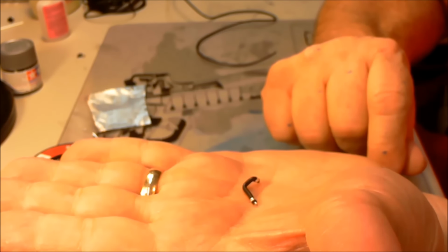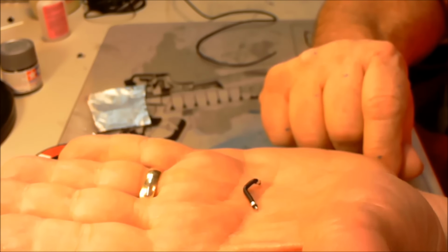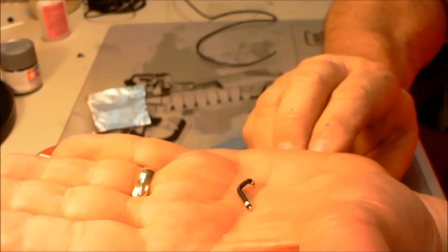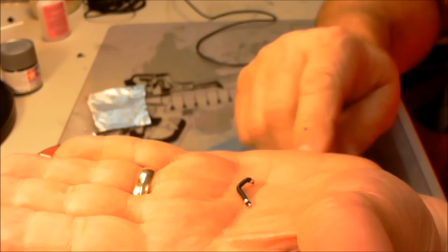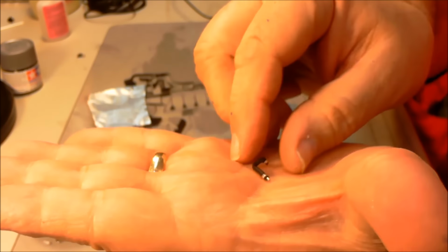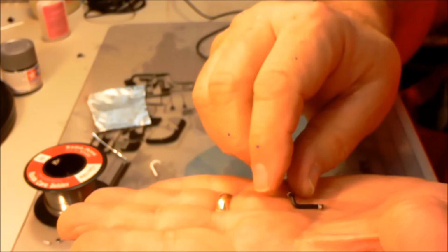Of course, I think it's Chrysler and Dodge used a wire spring type clamp for a while. That would be no problem. All you have to do is just wrap a wire around it, twist it, and you got a spring type clamp on there. But that's the way I make my radiator hoses.